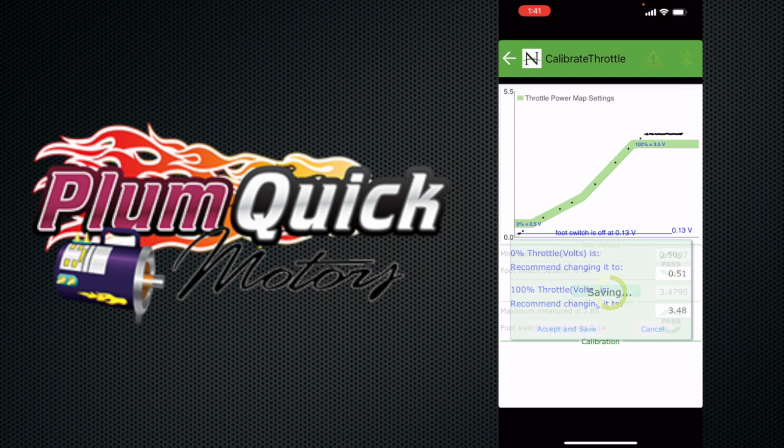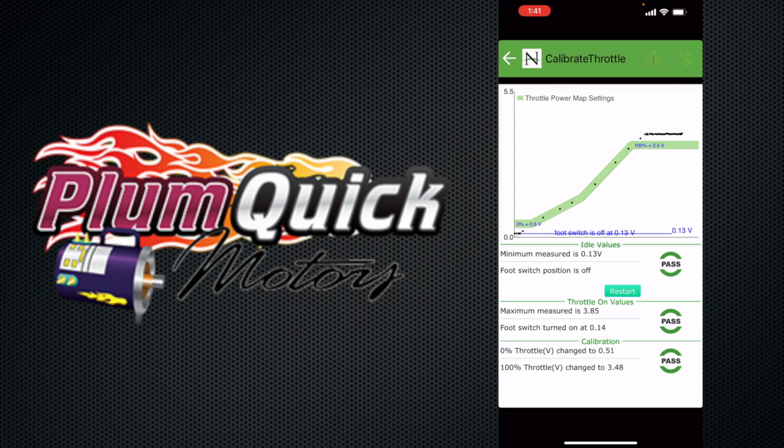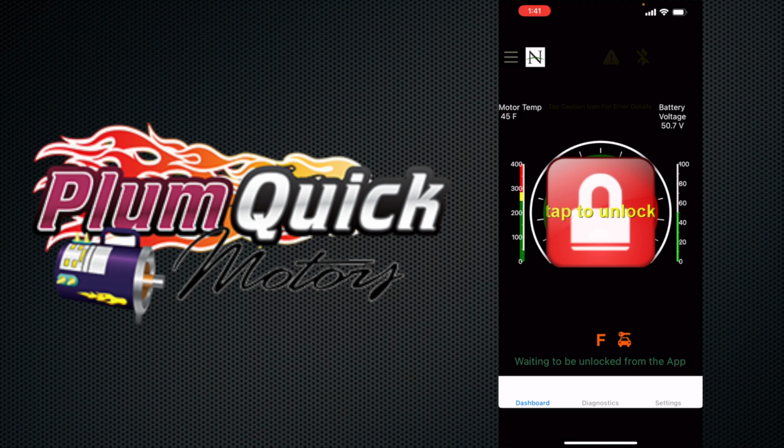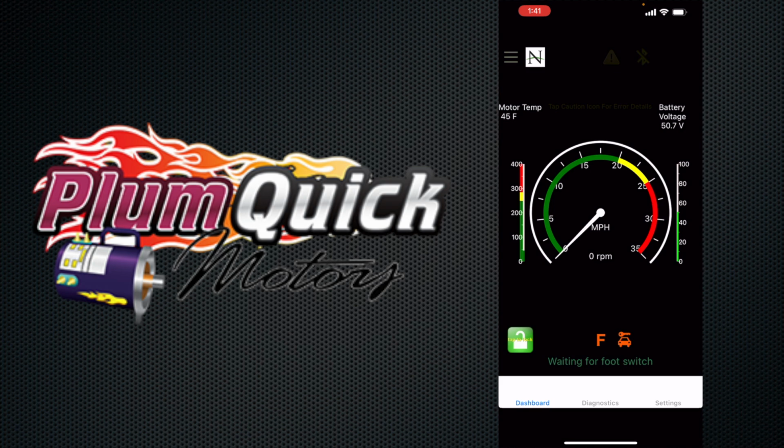Okay, everything is set there. We're gonna go ahead and exit the calibrate throttle screen. Now we're gonna need to go back to dashboard and we need to untap the lock here, or make sure it's green at the bottom left. The reason it was red there is because while we were calibrating it, we wanted to make sure that the golf cart would not move during the calibration settings.